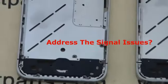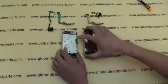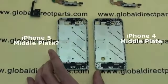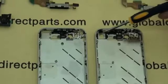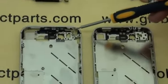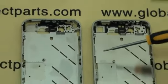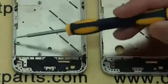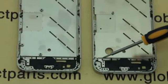Now we'll take a look at the back of the middle frames. The structure on the back is also quite different. The camera hole isn't there, as we saw on the front, but there's also an extra screw on the iPhone 5 that wasn't on the iPhone 4. The holes are also all in different positions. Moving down to the bottom of the middle frames, there are three extra screws on the iPhone 5, probably to make the phone a little bit more sturdy. At the bottom, the hole configurations are placed differently on the two middle frames.